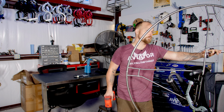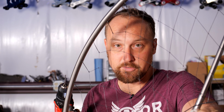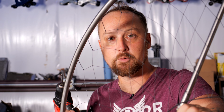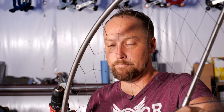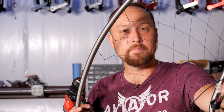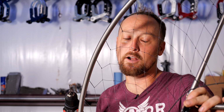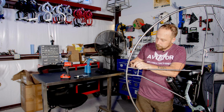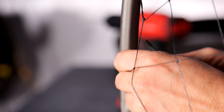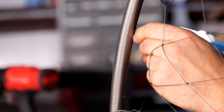The advantage of having a riveted net is it's a lot cheaper. Like I said, the replacement for the Limitless is $70 versus a few $100s for some of the other manufacturers. They're pretty expensive for the whole net assembly. It's just a bit tedious to replace it. But take your time, get some good tunes on, have a cup of coffee, whatever, and knock it out. It's not hard at all. So once you've got the rivet heads drilled off, there will be a little bit of remaining rivet here. Stick that little punch in there, pop the net out, and so on.